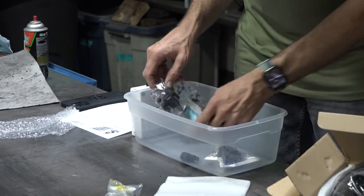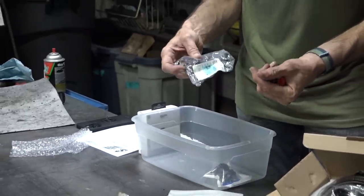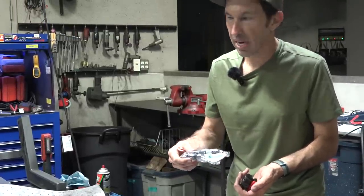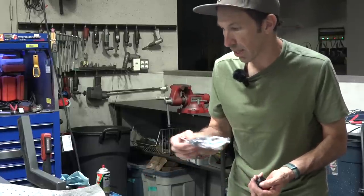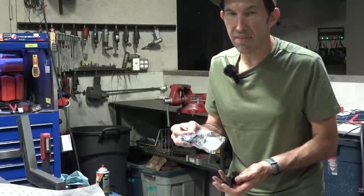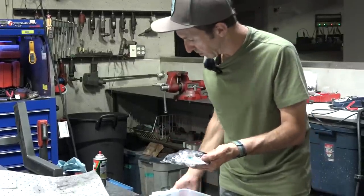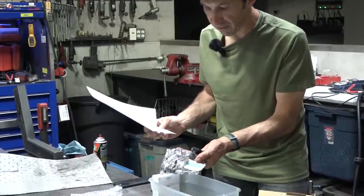There are a couple of problems with the scooter. First, the horn switch is straight missing — sometimes when you wreck a scooter your knees or clothing catches the switches and breaks them. Also, the turn signal switch just works from time to time. This scooter has always been close to the coast, and 16 years of that coastal sea mist gets to the contacts in these switches. The switches are rather inexpensive. For this scooter you need about five different switches.